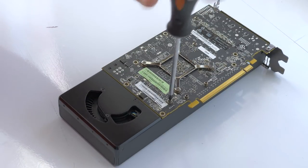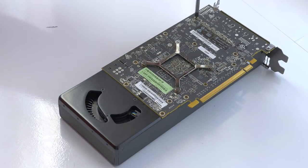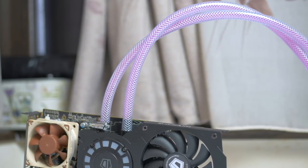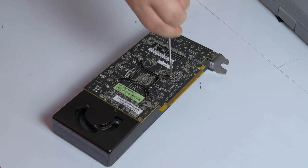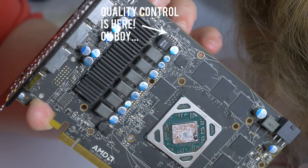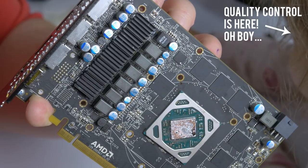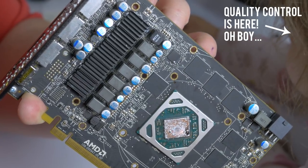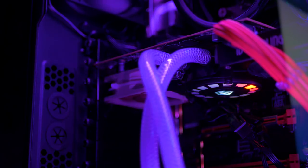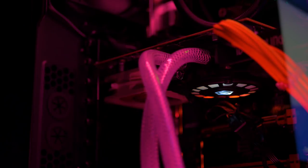And that's it, you're finished. You can now either throw away the coolant or keep it for future projects. You might have noticed that I've crossed the streams — the two tubes. This was on purpose since I hate how one tube always sags, and that's why I intertwined them; it gets rid of unsightly cable ties on the tubes for me. I went ahead and got this on the RX 480 it came from — still using gallium-based thermal compound for this by the way — and I'm happy to report the temps are a couple or more degrees lower now, with much longer tubes, no tube sag, and it doesn't really look bad under the right light. I'd say I'm around 90% happy with what's here and the only thing I'd change is the coolant. I'd get some pre-mixed pastel orange or red, or even UV green, and use that instead of this homemade stuff. If you're planning on doing something similar to your AIO, let me know in the comments down below.